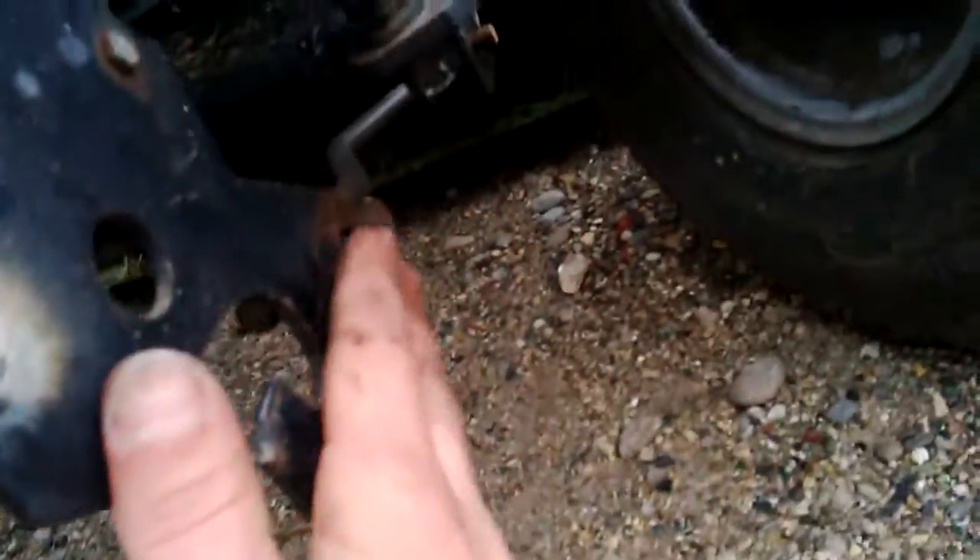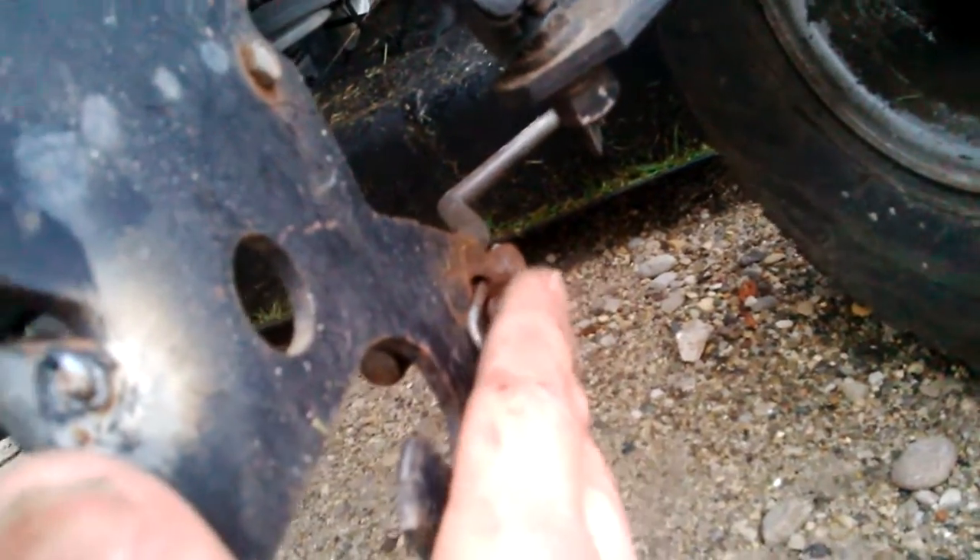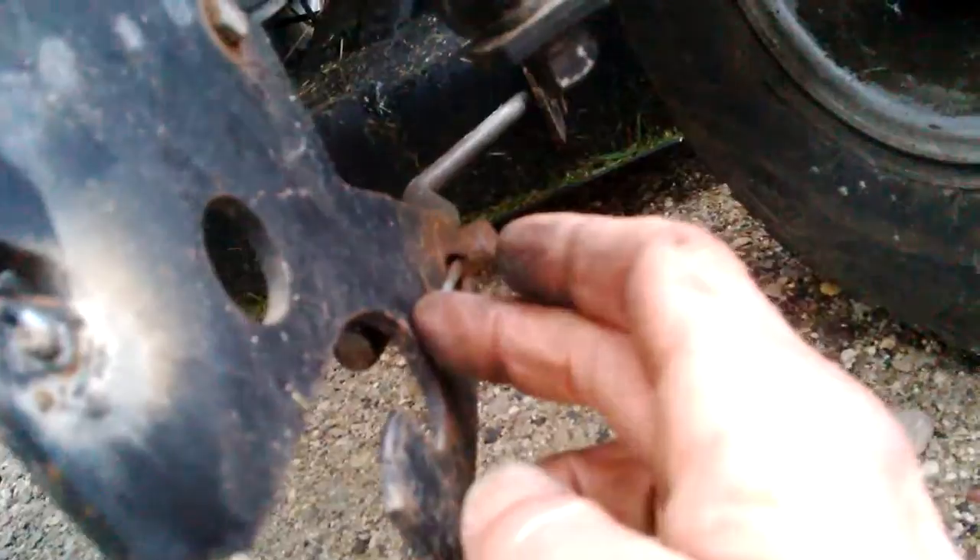This rod that goes back to hold the mower deck — at some point one of the clips had fallen out, and when that happened the rod had gotten all twisted up and bent around. So I took two sledgehammers: one to work as a flat piece on the inside, the other to swing. I tried just prying it back, but it's some heavy-duty metal — tougher than I was expecting. I got it straight though, and the mower deck lines up better now. I made sure everything was connected and adjusted, welded up the patches, and it sits really nice and level now — that's a major bonus.